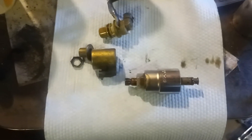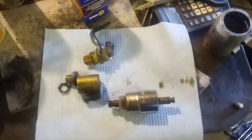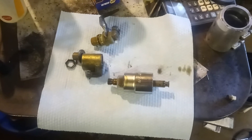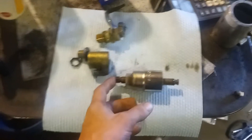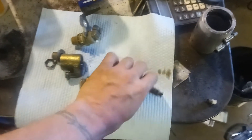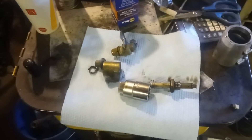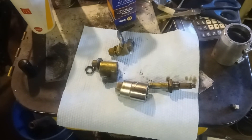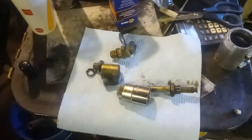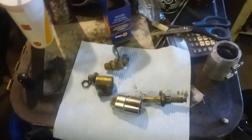I've done similar things on an old GM 6.5 diesel to pull the injectors — I built something like this because you need a 30-some millimeter deep socket. It's a good little trick for a guy with the Power Stroke. Most of the time, nine times out of ten if you're on the side of the road it's one of these sensors — nothing to do with your high pressure oil pump or anything like that. The fuel pumps in those trucks are awesome and seem to last a very long time. A small sensor like this can keep your eight-thousand-pound Super Duty from going down the road, so if you're making long trips, have a spare and know how to change it.